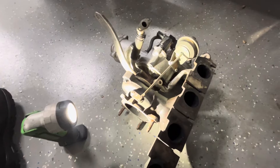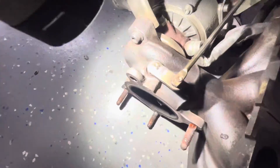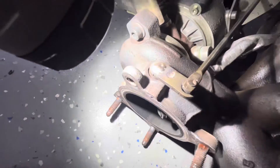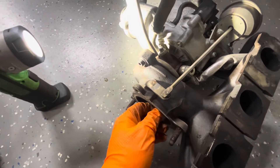Typically we end up replacing the turbo for this. There are repair kits, though — even though it's not technically a very serviceable part, you can see the way it's assembled here: this lever goes through and then it's welded — or maybe even brazed — into place. But if you want to do one of those repair kits, that's something you can do.